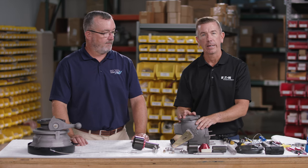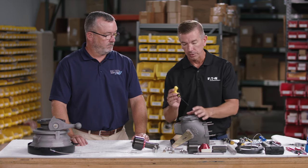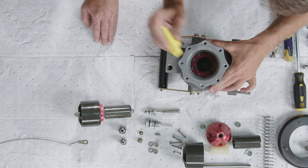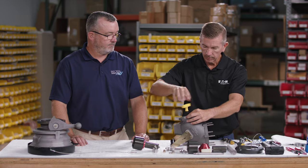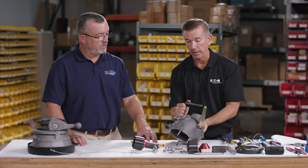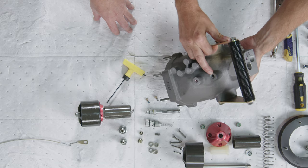For this video, we're not going to disassemble the main piston. With the main piston assembly and crossover tube removed, the next step is to remove the seal retainer using an allen wrench to remove the four securing screws. The main indicator that you need to replace the seals is if you notice fuel leaking from the small vent port on the front of the elbow — this indicates the Teflon seals inside may be cut.